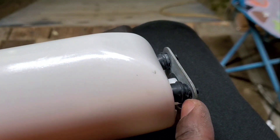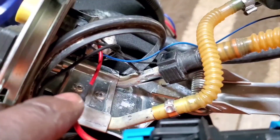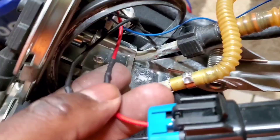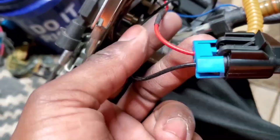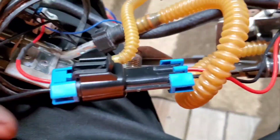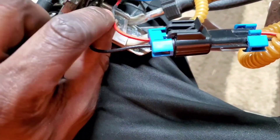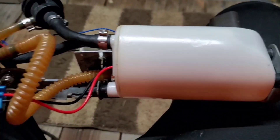Once that's in place I'll make sure it gets pushed down good. I went ahead and did the wires using a soldering gun — that's the best way to do it. You want to make sure all the wire is taped up pretty good so in case any fuel splashes up there it won't get into the wiring. You want to solder it because if you try to twist it, the shrink wrap tape won't fit around it that good.